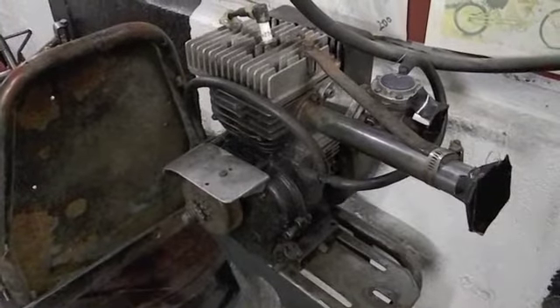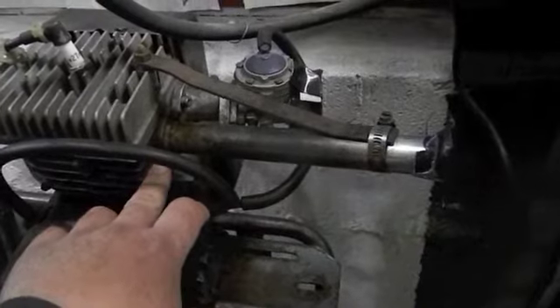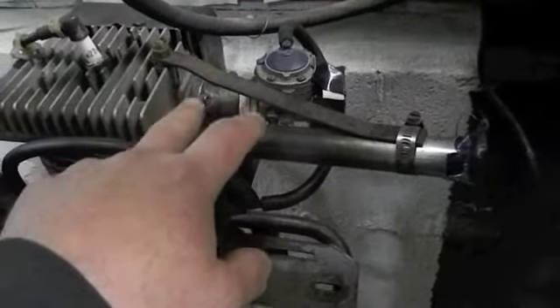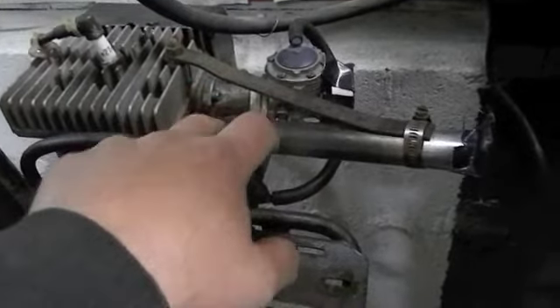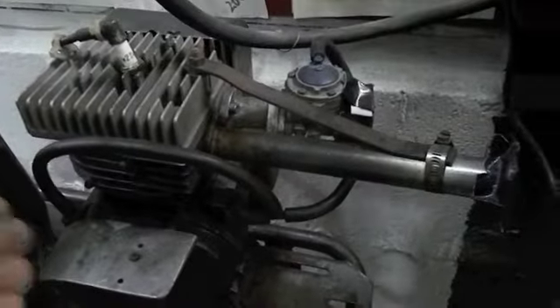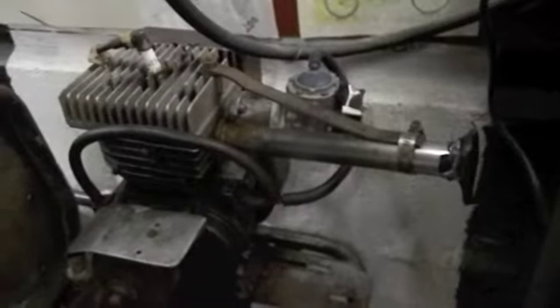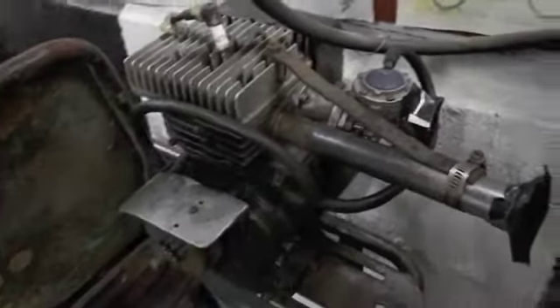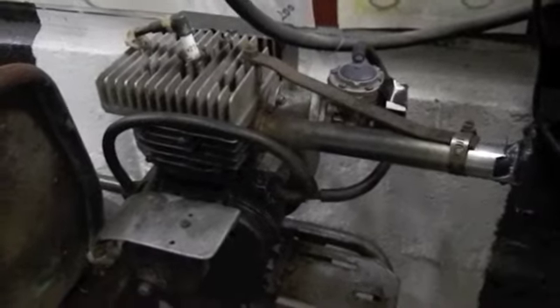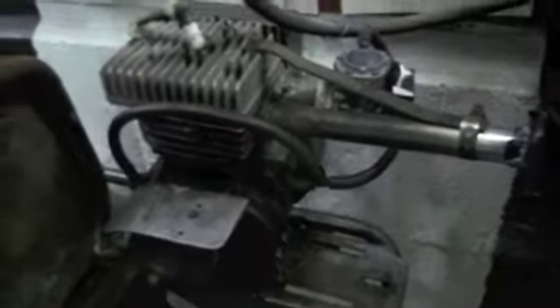Some of them are cast almost identical - the blocks. But if you guys are familiar with two-strokes, the way they run these is you have the ports right through the side of the cylinder wall. Some of them have three ports, some have four. Some of the chainsaw engines only drill the two center ports and leave one or two ports blocked, so you just don't get the power out of it. I also started learning about the different ways to port a two-cycle engine and how it affects the timing, which only makes sense because the piston goes by the slot - if you raise the top or raise the bottom it affects the timing.